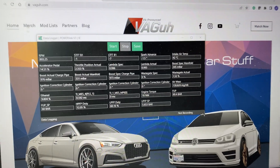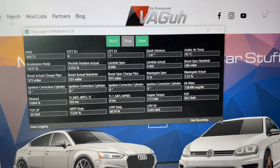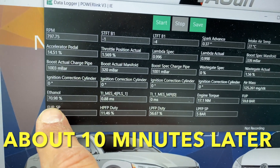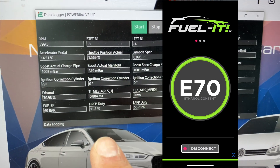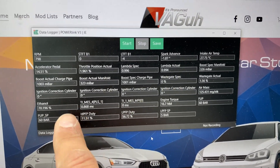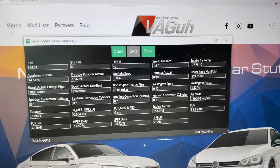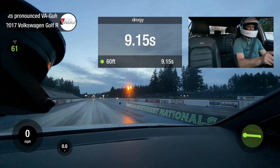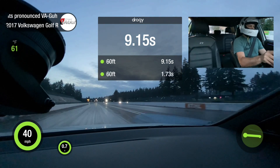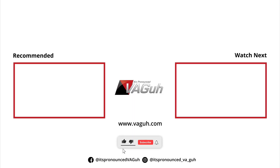I'm going to leave the data logger running while driving and see how the values change. I'm now at 70–71% ethanol, and my FuelIt device is also bouncing back and forth between 70 and 71, so this is perfect. I'll have to reach out to Integrated Engineering to find out the ideal ethanol content, but the tune can handle anything up to E85 — I'm just curious to try out different power levels at different ethanol percentages. Sorry to leave you hanging, but you saw the 0–60 at 3.75 seconds — this tune is quick. Make sure to subscribe so you can check out the next video featuring the full run and a bunch of other runs. Thanks for watching!